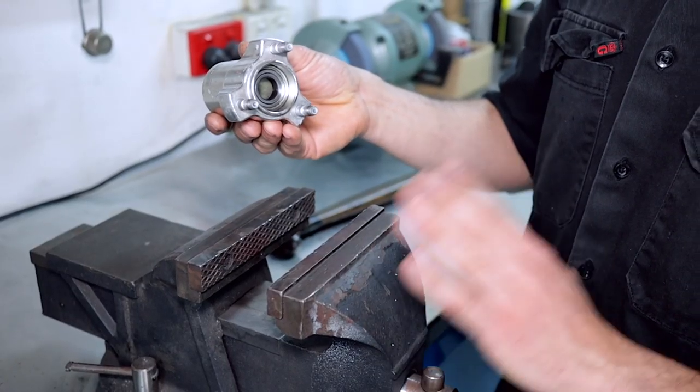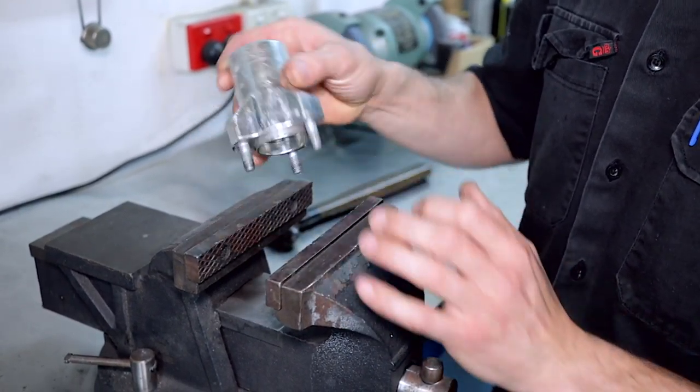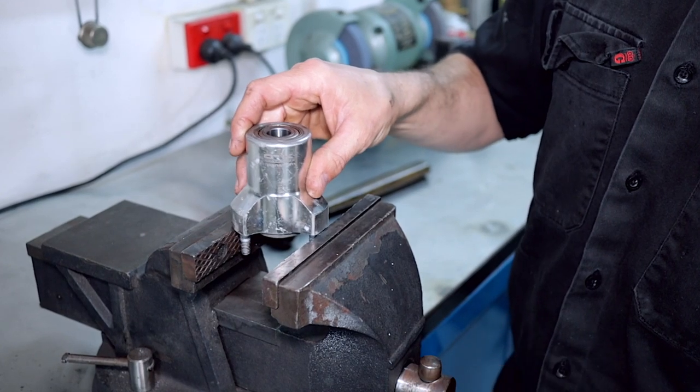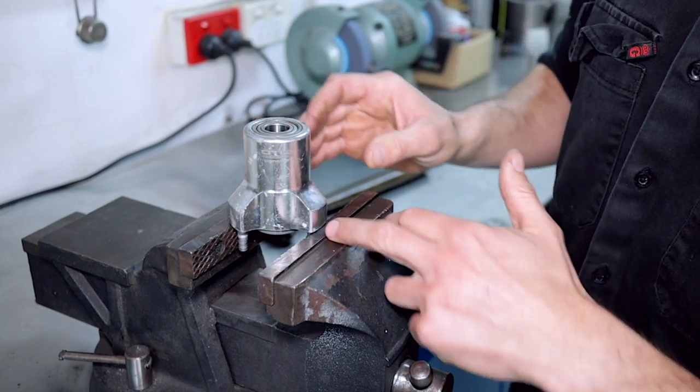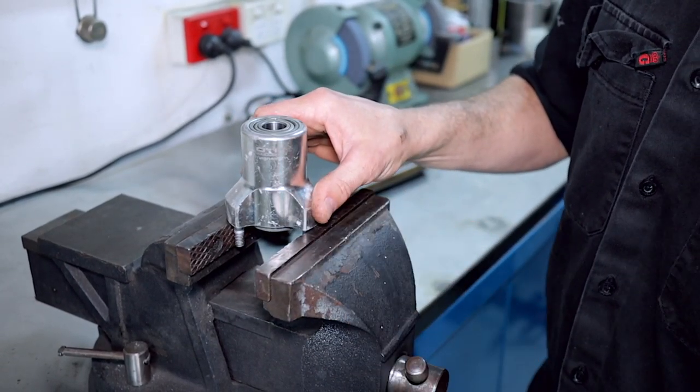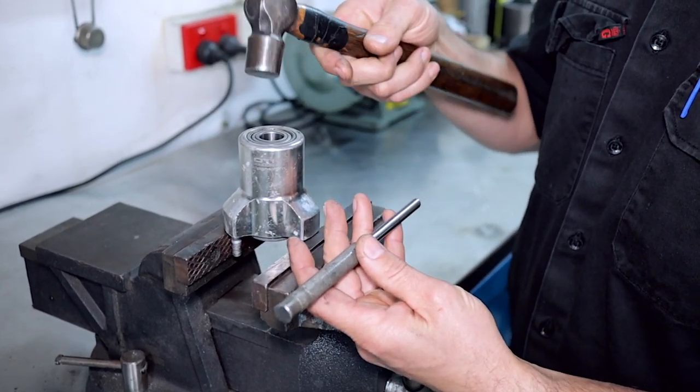So the first thing you want to do is go over to your bench vise and open it up so that you can fit this part of the hub down inside the vise like this. You can do it up a little bit, but you don't want to crank the vise up or you're going to bend all the studs. So just like that. And then get yourself a pin punch and a hammer, and we're just going to knock